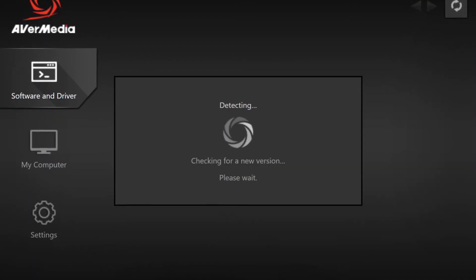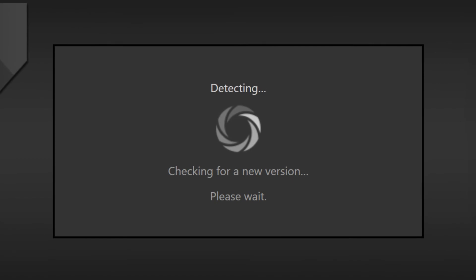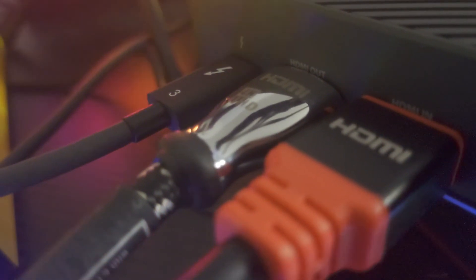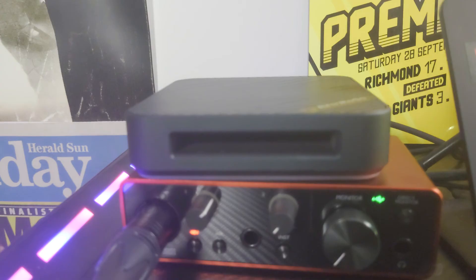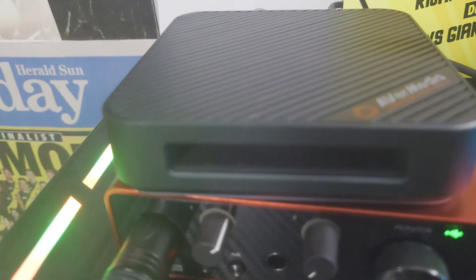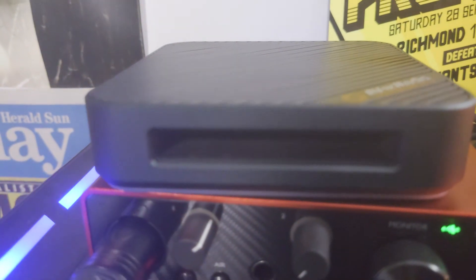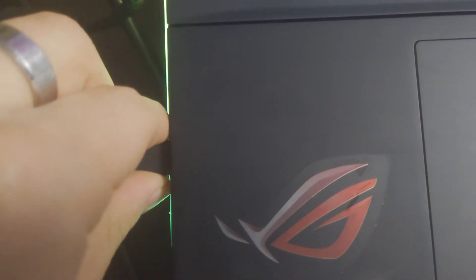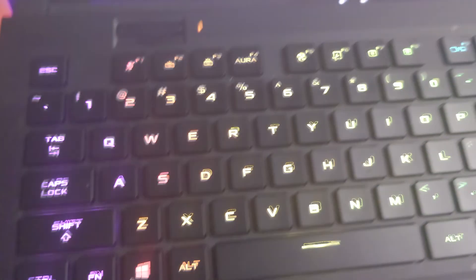If you're still running into problems and your Assist Central is showing nothing is detected, close Assist Central and make sure to unplug the Thunderbolt cable and wipe it with a microfibre cloth. This might seem like a last-ditch effort, but I assure you I encountered this. I literally had to unplug the notebook end of the Thunderbolt cable, wipe it with a micro cloth, and insert it again upside down — only to then receive the Windows prompt that a new device was connected.